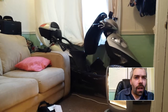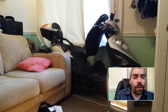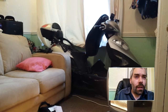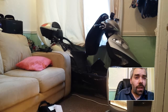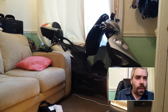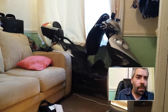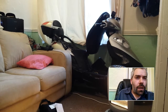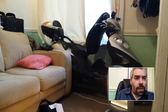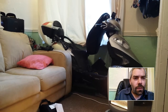I've been having a look online today and I thought there was a fifth battery shunt mod for the geo out there but it doesn't look like it. You can see my geo here in front of me and it looks a bit beat up but it's pretty decent. It does its job — I replaced the mirrors with some lights up there and I added a screen at the front to run a video feed from the camera at the back. But when I got this geo it had four 12-volt batteries in the footwell and it was pretty sluggish and heavy, so when I was trying to go up a hill it wouldn't really move.